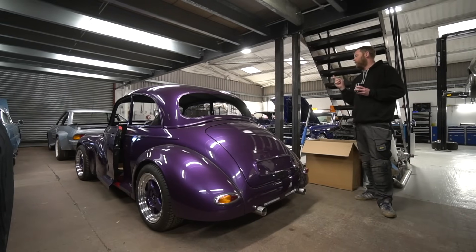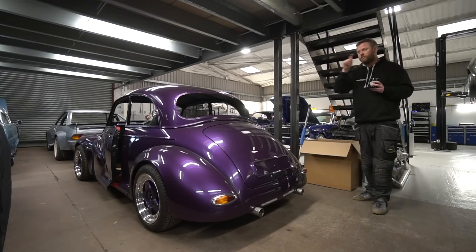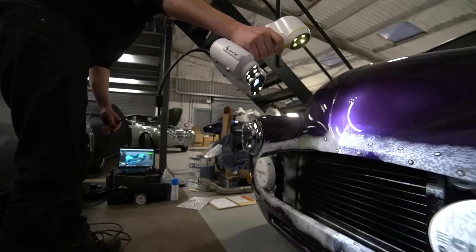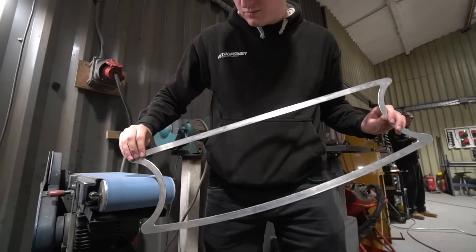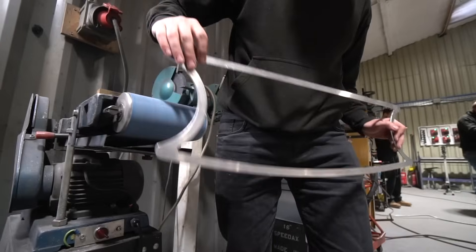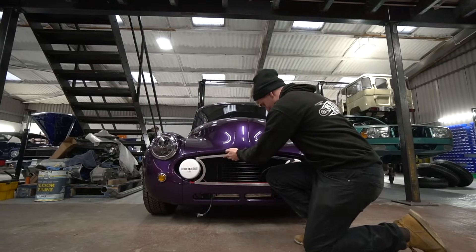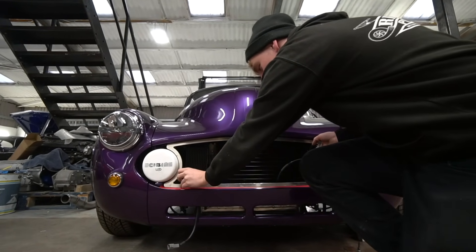On the Morris, we've been mainly working on the grille design - making the bezel that sits around the radiator grille. George has now done a 3D scan of the front and drawn it up in CAD. We've kept it really simple - just a 2D plasma-cut aluminium surround around the grille - and we're going to bond on some little studs on mounting plates on the back of that grille surround. That's been made and has just gone away for anodising with a load of other bits. When it's back we'll try it on and bond the mesh into it.